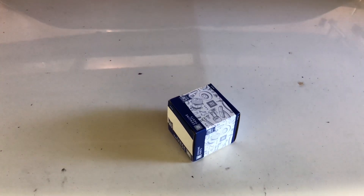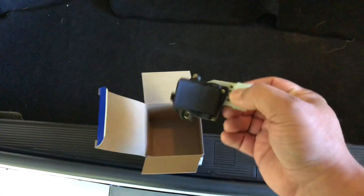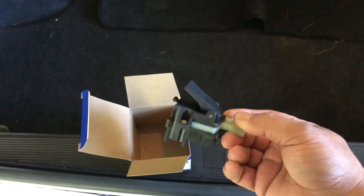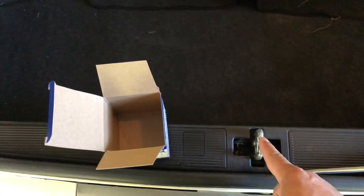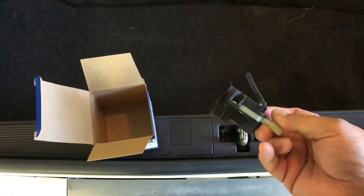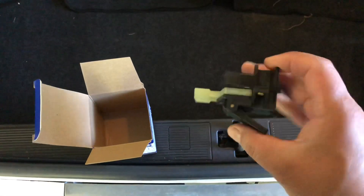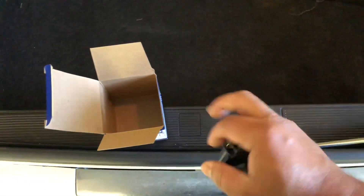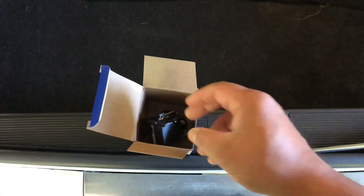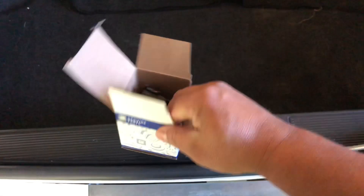There's a solution. What I'm talking about is the pull down switch — this is almost always what's going to be bad. In fact, I don't think I've ever had this problem where the solution was not the switch. If you get one out of a junkyard, if you can still find one, it's likely to be bad just like yours. They're cheap — you can find these for around $20 or $25 on Amazon or eBay, and they're still made. This is the GM part, or at least they're still available.